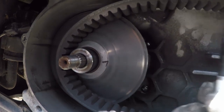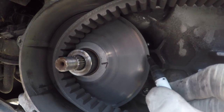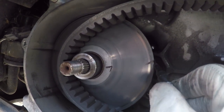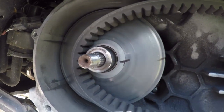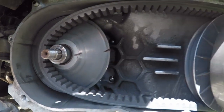In order to do that I'm going to mark on the variator how low the rim can go, just by using a marker and marking the lowest point and the highest point. I will then add a shim washer to get the rim to go even lower than it does.